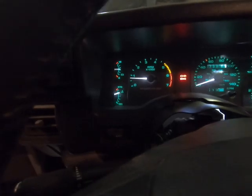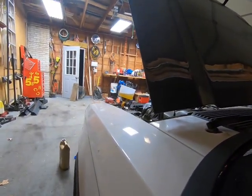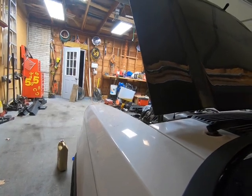It doesn't seem to be making a ton of progress, and it doesn't seem to act the way I thought it would. You can see there it's running warm, and every time I run it up high at like 2000 RPMs, the level will drop and the temp will get down there, but then once I let off, the pot starts bubbling real bad and the temp just goes back up again. The temp's really high now.